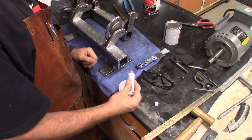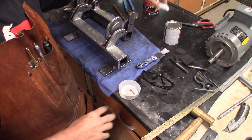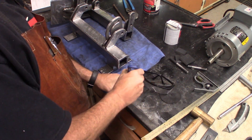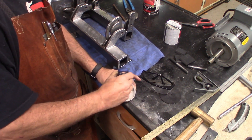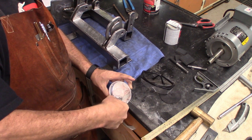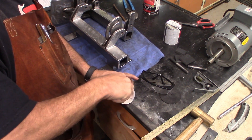I just squirt a little bit of hardener in there. I know there's an actual measurement you're supposed to do, so much per so much — I've never done that and I've always had pretty decent results. If you've ever wondered why Bondo is pink, it's the hardener that turns it pink. It actually starts off grey. And I'm definitely going to have plenty to do what I need to do here.